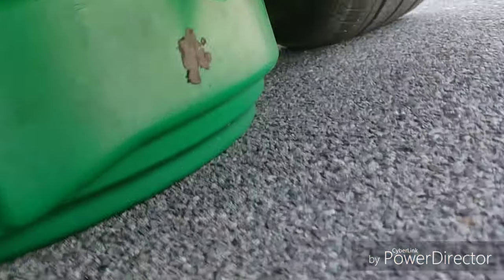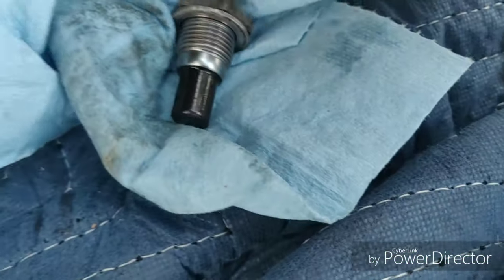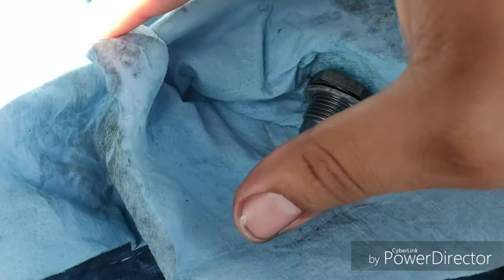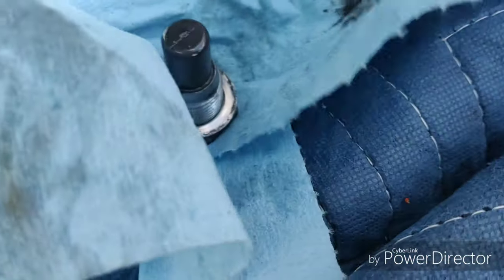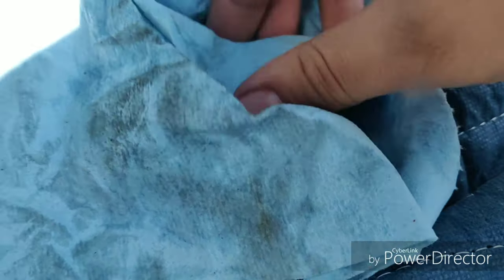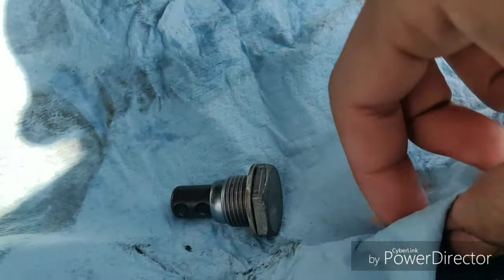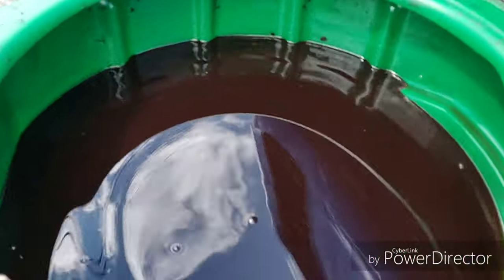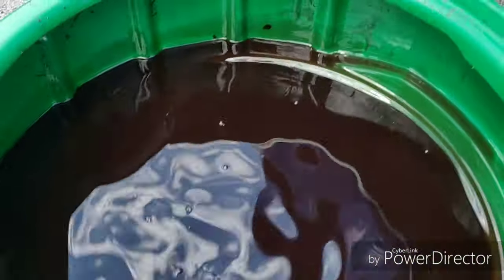Doing the second drain now. I just stuck my hand in there — that was pretty hot. Let me see how much metal actually gets on this. More than I expected — I mean I guess there was still residual fluid in there. Look at that — and we had just wiped it clean. This is why you've got to do the double drain. For the second change, you can see the fluid is a lot more red and less brown, with no black streaks.